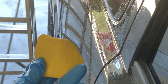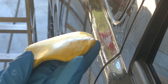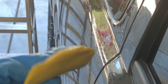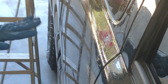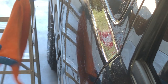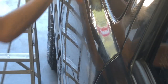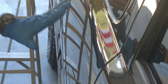After doing just that door, you can see there's a little gray tint and some blackness on the clay — that's all the junk it just picked up, which is why you do this step. After you're done, the surface will feel like it's already been polished — almost glass smooth — because you've removed all those surface abrasions. Set the clay bar aside, then take your rag again and wipe all that detailer spray off, because you want the surface to be dry before you polish. Make sure there are no drips or anything.